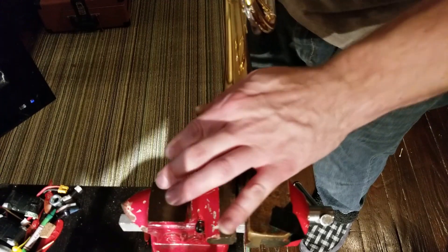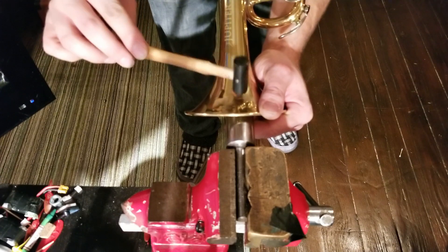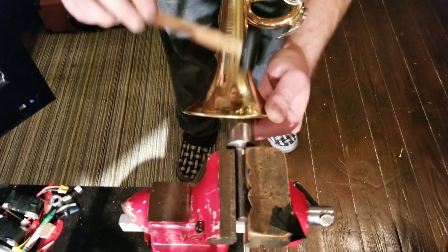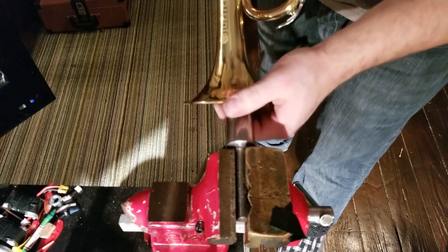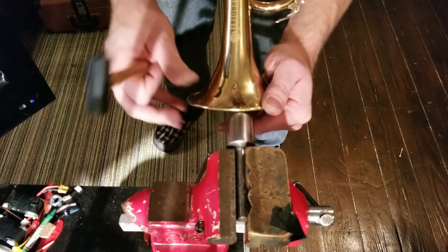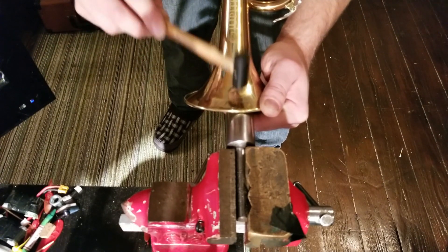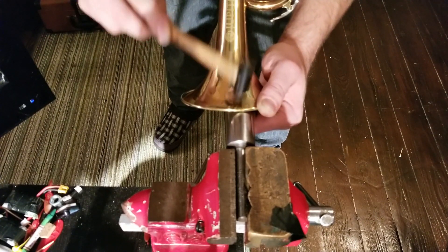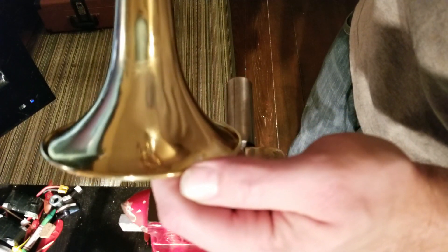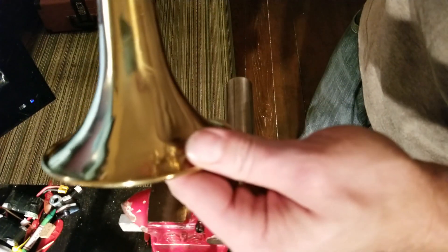Let's roll out a little more — there are a couple of nasty little spots. You can take this as far as you want to go. Now it's just finding the remaining peaks and valleys. Right there there's a little wobble, my reflection gets skinny. You're just looking at how the light reflects — all these waves. Keep rolling until those waves are gone.